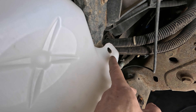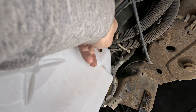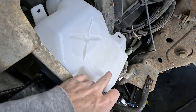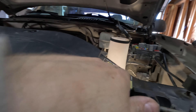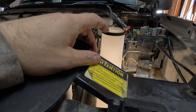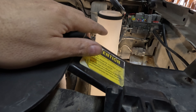That hole back there — you could technically make that work, but there's a big gap behind it, so you'd have to make a standoff or use some all-thread and thread that in. I find I need to do more to support this, but you can see it's in. One thing I checked is that this fill neck sits considerably higher. I checked with some tape and grease, and on this truck — which is an HD, so it's got the bigger hood — this isn't a problem. On the non-HDs, I'm not sure if it is a problem or not.